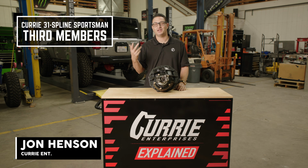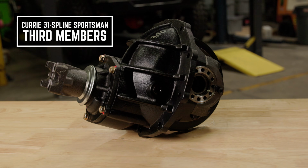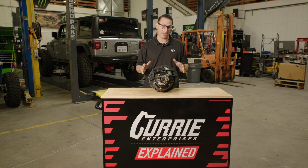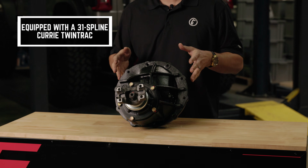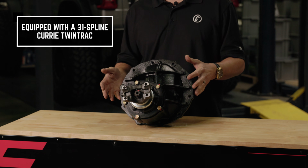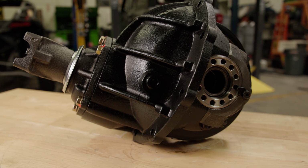Hey, what's up guys? I'm John Henson from Currie Enterprises, and we're going to talk about our 31-spline Sportsman Case Third Members. Our 31-spline Third Members are going to all come equipped with a 31-spline Currie twin track. The Currie twin track is a helical gear style limited slip. Some people have nicknamed that a worm gear style. Basically, what does that mean?